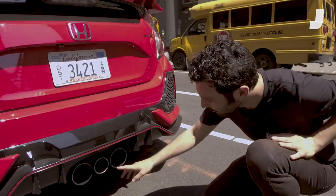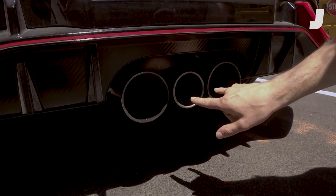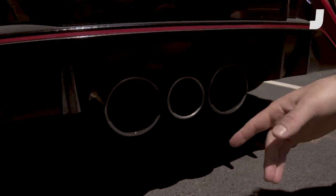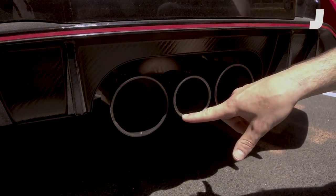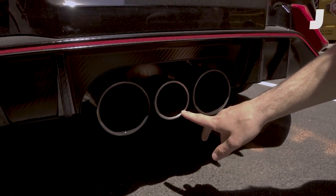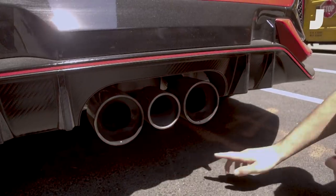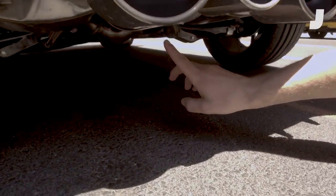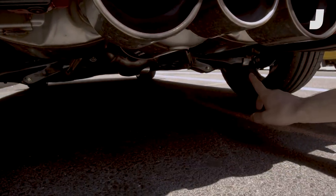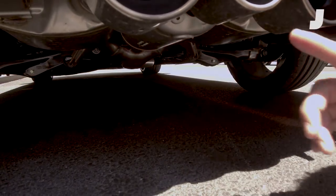So they figured out a trick with this thing. You can put a low restriction exhaust — a small one — so that when you're just driving around on light throttle, you hear a lot of the engine sound. But once you're driving on the highway and you get a lot of exhaust gas rushing through, it actually stalls out on the middle one and then routes through the two larger ones. If you look underneath, you'll actually see middle muffler, big muffler, big muffler. So when you're driving on the highway, you get the big mufflers and it's not too loud and droney. And when you're driving around town, it's really kind of loud and sounds cool.